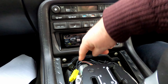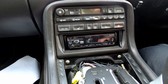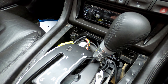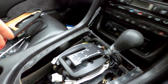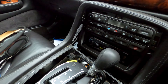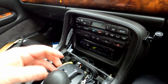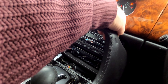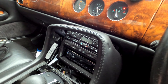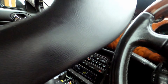The next bit is the two torx screws — I'll get those removed and then the whole centre console just slides out of the way. Once you remove the two bolts down there the centre console just slides out. I'll get the ignition back on so I can move the gear stick. Put that all the way into neutral. It is as simple as that.